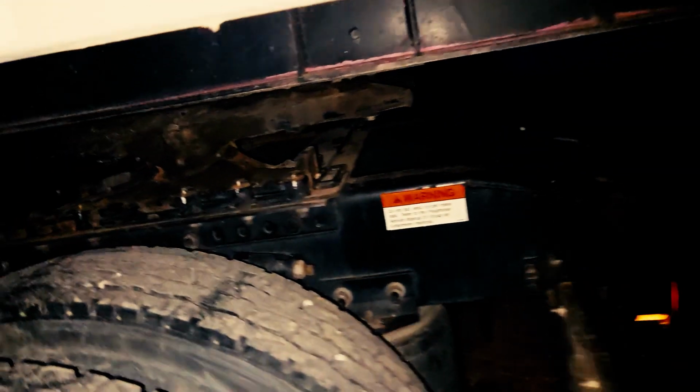Now, you would inspect your trailer, the frame rails on your trailer, from the front to the back. You would tell the examiner, I'll inspect both my frame rails to the front, to the rear of my trailer, making sure they're properly mounted and secured, not cracked, damaged, or loose, free of any damage, no cracked welds. You also will inspect all of your floorboards throughout the entire trailer to ensure that there are no holes and no damage to any of your floorboards. You're also going to inspect all of your cross members, all from the front to the rear, all the way across your entire trailer, to ensure they're properly mounted and secure, not cracked, damaged, or loose, no cracked welds.